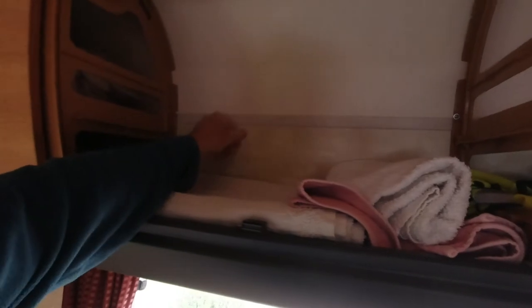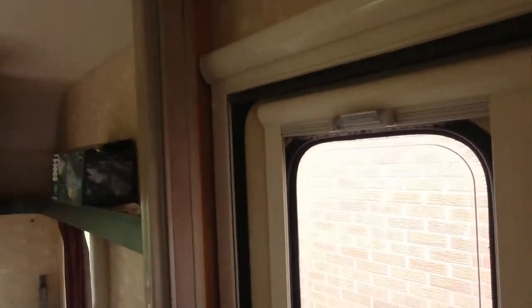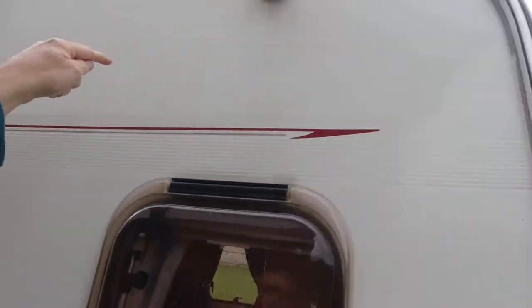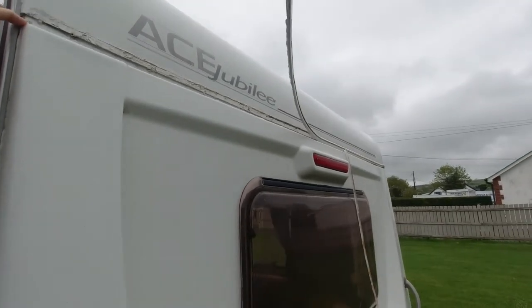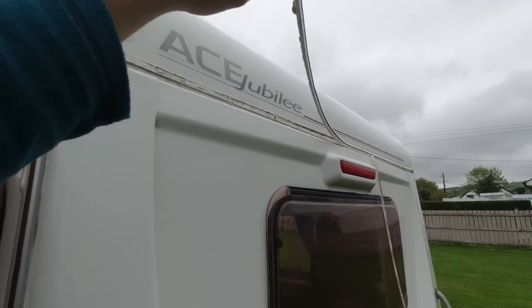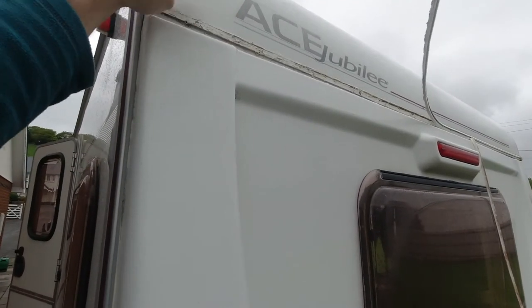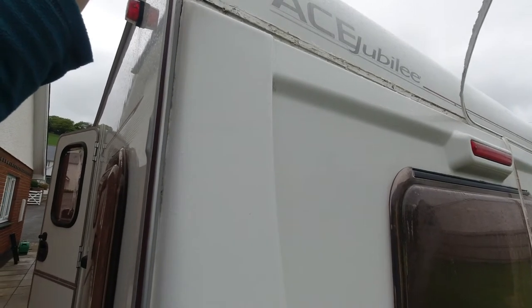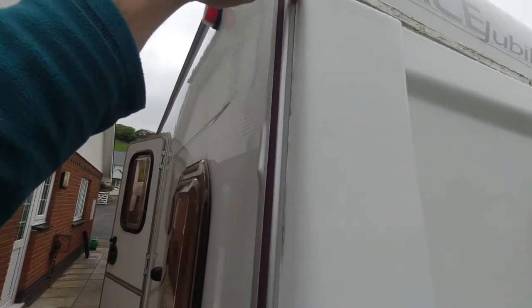The softness stops about three quarters of the way across the back of the van. I followed this line all the way through the caravan and at that level it comes out exactly at this point. I've already done a bit of investigative work and started to remove the beading — it's where the roof and the back panel meet and overlap. There was a screw missing, leaving a slight hole, and the water ingress is coming from there.